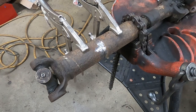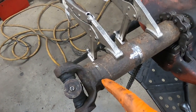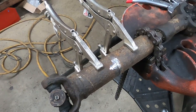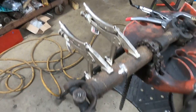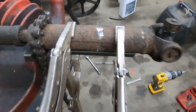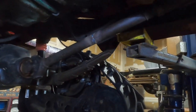I'm making some ghetto drive shafts. Normally I would cut this weld off, cut the tube back, insert the yoke and tube, and dial indicate it in on the Jeep. But with the tracks on there, it's such a bear to turn the axle that it'd be hard to dial indicate it straight. So I made a line, got it clamped to a piece of angle iron, and I'm just gonna weld the tube up. Got the ghetto drive shafts installed — they seem to run pretty straight, straight enough.